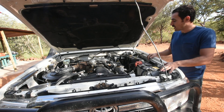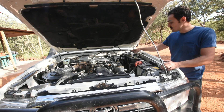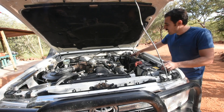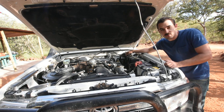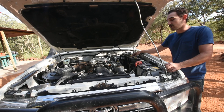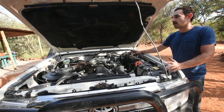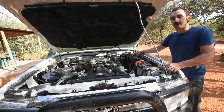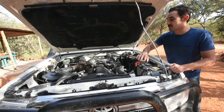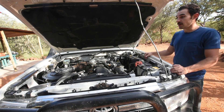The other thing you can see in this shot is the dual battery system. Just like in Shadow, they have two dual batteries — a huge deep cycle battery here. Interestingly enough, they use the exact same intelligent solenoid from National Luna, which is the exact same gear that we put into Shadow. The idea is the fridge is hooked up to this, and the fridge is not going to drain the main starter battery — it'll just drain this deep cycle battery. Very similar setup. You'll notice there's a lot more space under the hood; it's a much bigger, much more substantial vehicle.